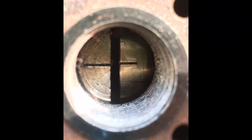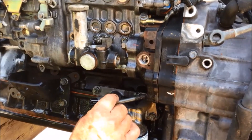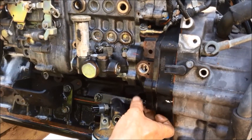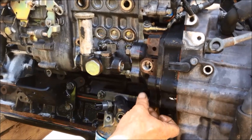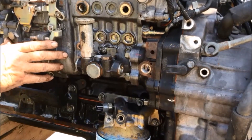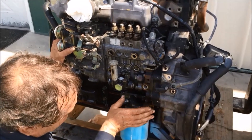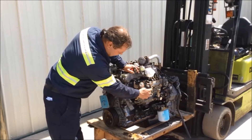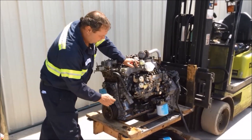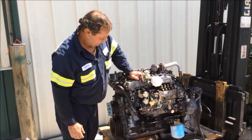Once you get it right, start your bolts and just snug them up good. Right before you get ready to tighten all of them, make sure your short 8-degree mark is lined up and your harmonic balancer is on 8 degrees. When it's lined up perfectly, then you can tighten all your bolts. Once you get your injection pump started with the short line — the 8-degree mark — lined up, install your brace back on the front, put your bolts back in it, and reinstall your lines as you disassembled them.